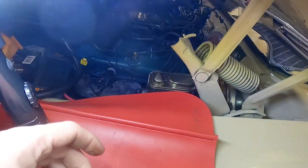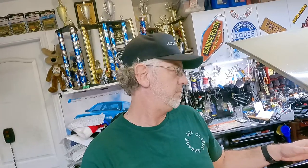And this was not even running it hard. This is taking it off the trailer, pulling it in the garage, and then starting it once to test the PCV. I wanted to test my PCV because if that's failing, I'm going to build up a whole bunch of pressure inside the crankcase, and that could blow out seals. The way you test it, you take a piece of paper and put it over an opening in the valve covers. I took out my breather element on the passenger side, put the paper in there, and it sucked down on the paper — there's still negative pressure in there. So it's not the PCV. There's something going on with the mating between the head and the intake manifold.